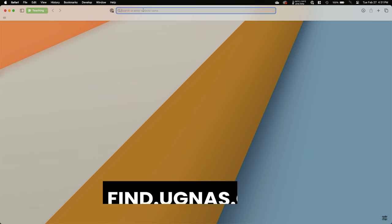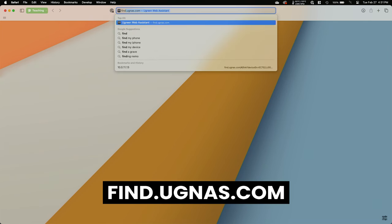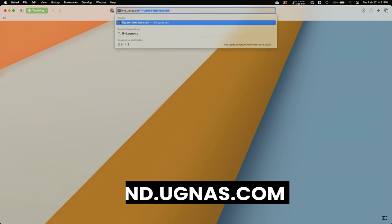Now that we have the drives installed and everything connected to our computer and our home network, let's look at the initialization and setup of the Ugreen NAS. The first thing we need to do is configure the NAS and get it working properly. In order to do this, open up any web browser on your computer and type in find.ugnas.com. What this is going to do is search your local network for the NAS.